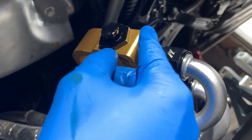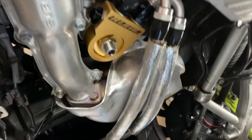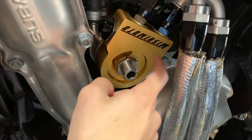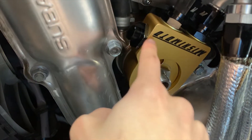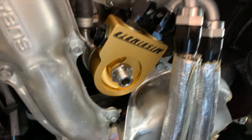I'm a little scared it might be a bit too tight. If I put it flat like they did in the video it's a bit too loose, so I'll leave it like this — there should be enough clearance. The main bolt here is 30 foot-pounds. I did a little bit extra just in case; if it's too much I'll pull it back. Everything looks good — no leaks or anything. Now it's time to fill up with oil.